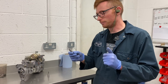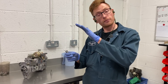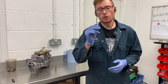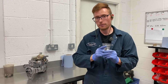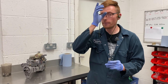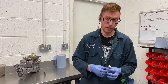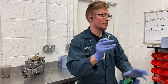The next key is the helix design. The clever thing about the way the Super Floyd element is made is it has a nice helix angle, which allows a nice progressive curve of power, reducing the jerking effect. One really big factor in making more horsepower — and this is key that everybody needs to remember — is duration. Comparing this element versus a comparable 8mm element on the market, at 200cc of fuel delivery, this will put the fuel into the engine in 2 degrees less crank duration. That's a big deal. You need to get that fuel into a tight window — once you start pushing past 40 degrees into the big crank duration numbers, that fuel might as well be going straight out of the exhaust, just creating heat and no power. With less CC, these things make a load more power.